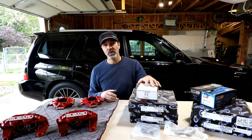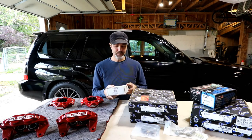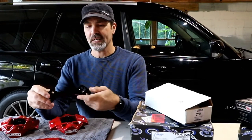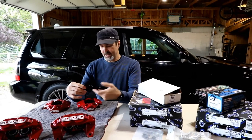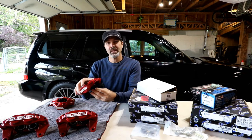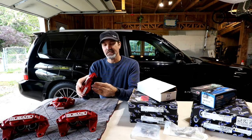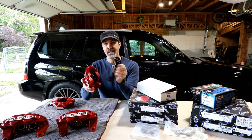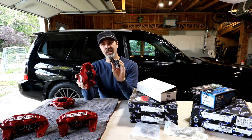Or the other option is you go with the Torque Solutions, or I believe there's a couple other companies that make them. This is an adapter kit that gives you a couple of brackets, just like this. This will bolt on in place of your factory caliper in the back. This bolts in there, and then the new calipers will bolt into those, and it spaces it up a little bit. So you use the WRX rotor, so I'll just say 2006 WRX rotor, and it sets it at the proper height, and you are all set to go. I think it's about a half inch difference in the height as to how this fits. Also, you'll see the stock bolt pattern, these outer two bolts, quite a bit larger than what this is. These go to the smaller ones. So we'll get more into detail when we get to putting these on.